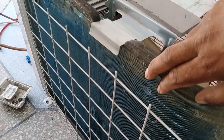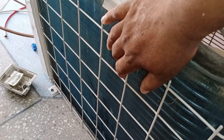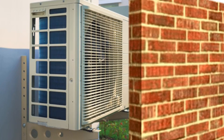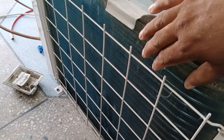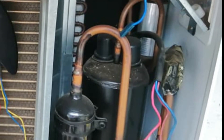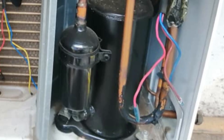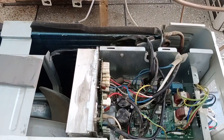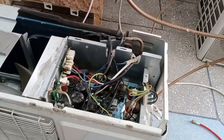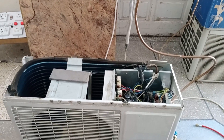The next reason is the condenser not being cleaned — I cleaned this condenser a while ago. If the condenser is choked with dust, or installed in a place with an obstruction in front of the outdoor unit, it will heat up. Another big reason the unit overheats is the compressor. If the compressor winding goes bad or is weak, the unit will start to overheat, and the circuit board IPM module will heat up a lot. Also, if the refrigerant is overcharged in the unit, the unit will overheat.